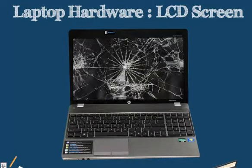If our inverter is damaged, then we may notice that our screen is very dim. We can't get it to brighten up. It looks like it's not turned on. But if you look really close in a really dark room, we may be able to see a little bit of image on it. Then that's going to be the inverter.